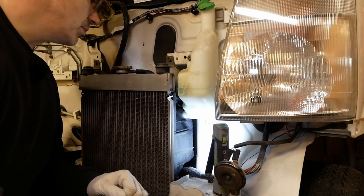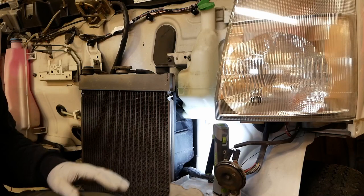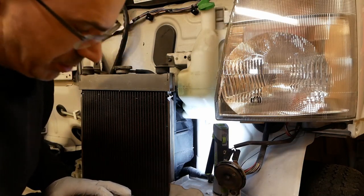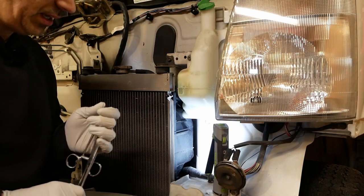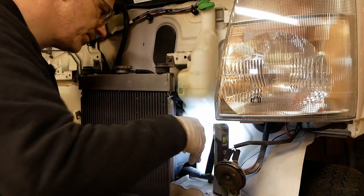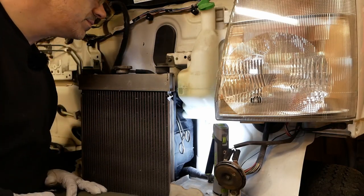We've got two hoses coming off this, and before I thought that one of them was just a drain for the excess, but actually that just comes out the top there. So this one, the back one of these two goes all the way back to the engine, and then the front one of the two goes to the radiator. So what I'm going to try and do is clamp them off so that we lose as little as possible and we don't let any air in. I just released that one from its clip on top of the radiator there. There we go. Fan shroud, I should say.